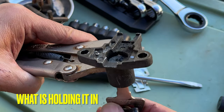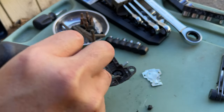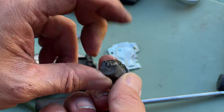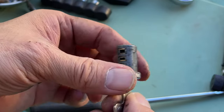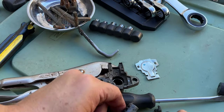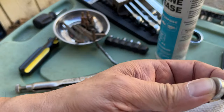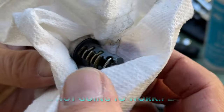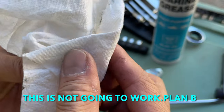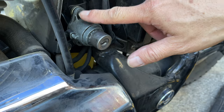Let's get the key in there and see what we have to work with. We've got a tumbler that's completely tumbling. There's a retaining pin here — push it down and that releases the tumbler. The pins are really greasy and dirty. I'm pretty certain cleaning this and re-lubing it would help, but I might switch the actual tumblers, so let's focus on getting this removed.